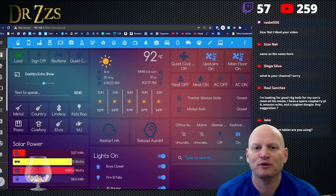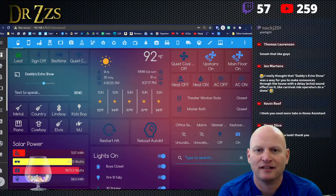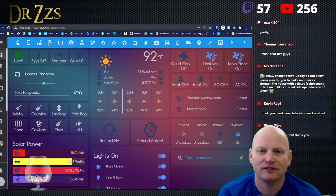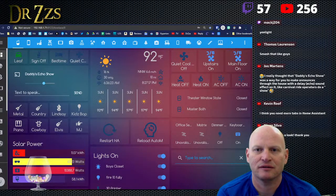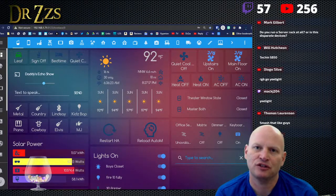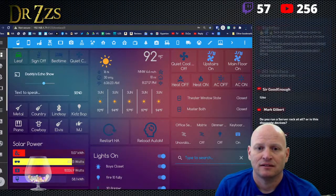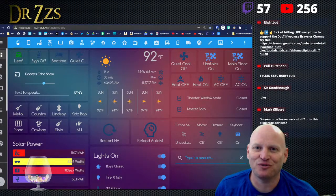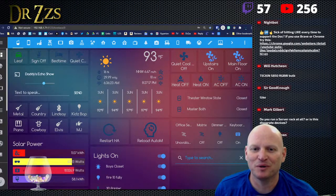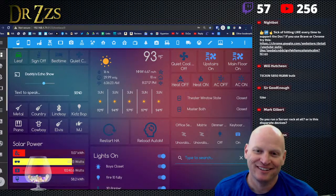Probably, like, are you super opposed to using just Tuya? Because if you use Tuya, if she would let you connect, you know, you're talking about his mom's and you don't live there, so there's some issue there. But if you just have any RGB Tuya bulb and you set it up to connect to the internet and then to your Tuya app, you can control it through the Tuya app and you can control it through the integration in Home Assistant. You want easy? That's easy. If you want to do it hard, then you set up a whole Home Assistant instance over at her house, and you use an RGB bulb flashed with Tasmota and control it through VPN. That's the hard way.